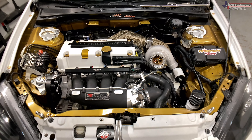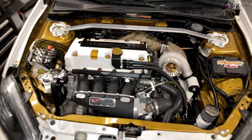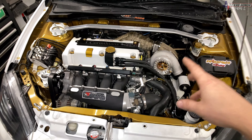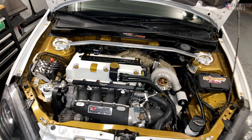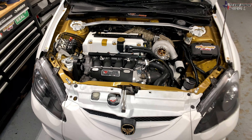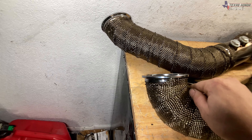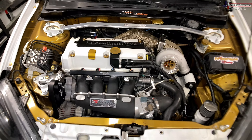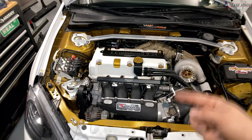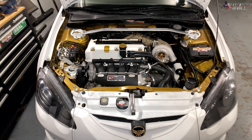Praise God, it looks amazing under the hood, and we got some vital information out of doing this bolt-on mock-up setup to see exactly where we're at. As for the turbo routing, I'm not doing a hood exit — I'm going to be running full exhaust on this setup. Most likely I will have to take that V-band adapter off and get this V-band cut off and a four-bolt welded on, which is not exactly what I want to do, but that's how it's looking. We now know the fuel line definitely needs to be tucked, as I assumed, and the coolant lines as well.